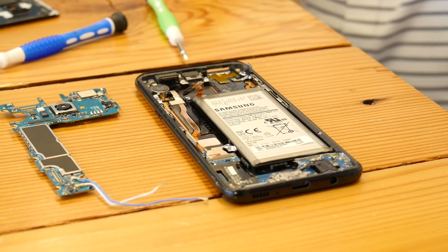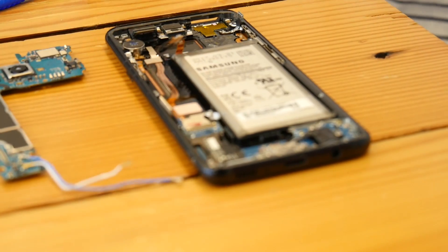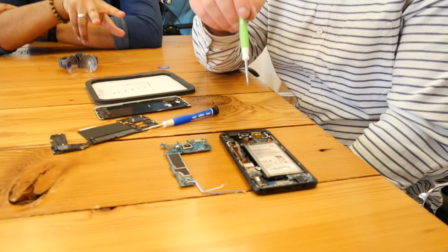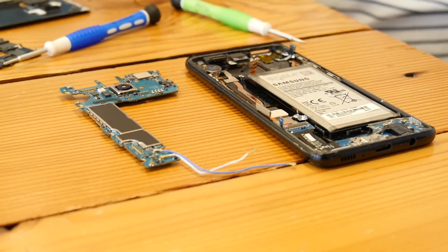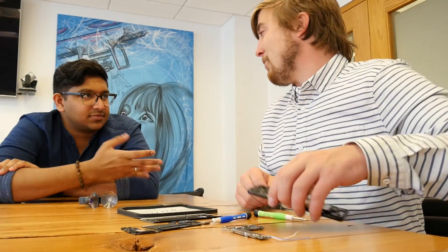You mentioned the battery bay is new — that's not common in most phones. Apple doesn't use a specific injection-molded battery bay. Samsung designed it so the battery doesn't risk moving around or bumping into the sensitive electronics, and they use a ton of adhesive to hold it together — that's an extra precaution because of what happened with the... we don't talk about that. We don't recommend you replace the battery yourself. You run the risk of puncturing it and getting lithium on you, and that's a problem with all batteries.